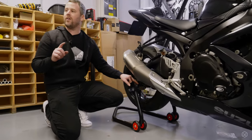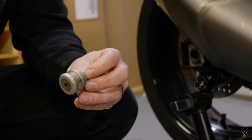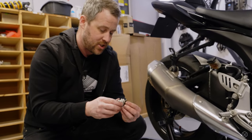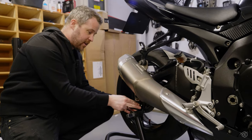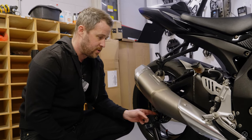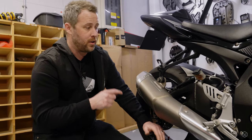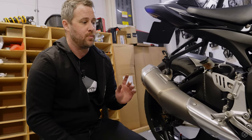First up are new cotton reels. The ones that came off the bike were metal ones the previous owner had fitted, but he'd basically ground the end of the bolt off, so they weren't very far into the thread — not very good. These R&G ones are not only good for putting a paddock stand on, but they also provide protection for the swing arm if I low side. They're chunkier for the paddock stand to grip, and the bolt comes out the other side too, so it's super strong.